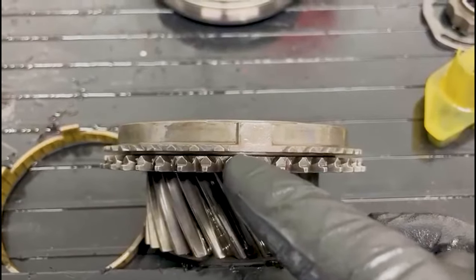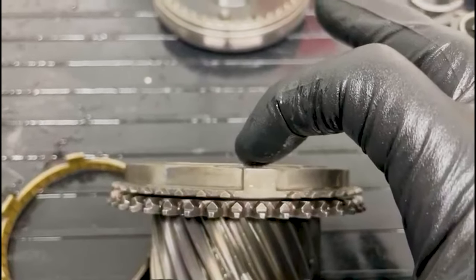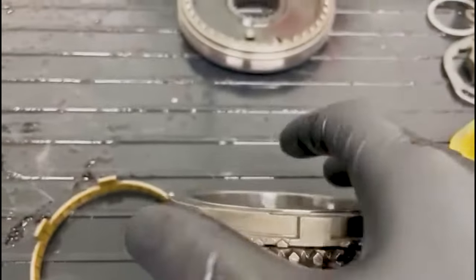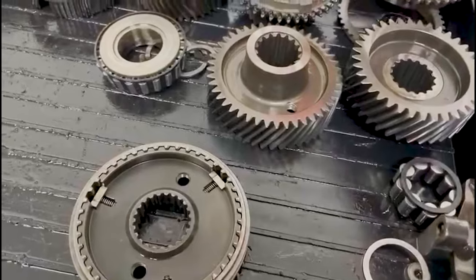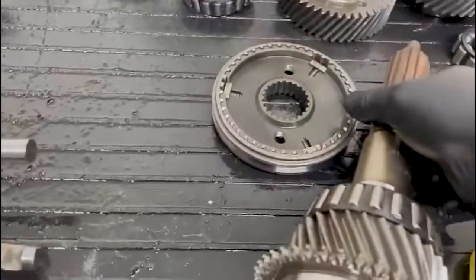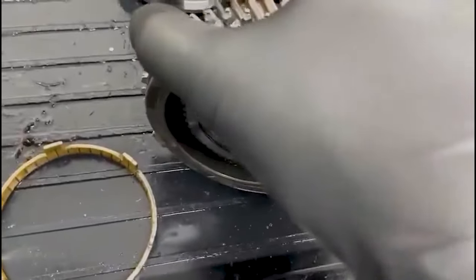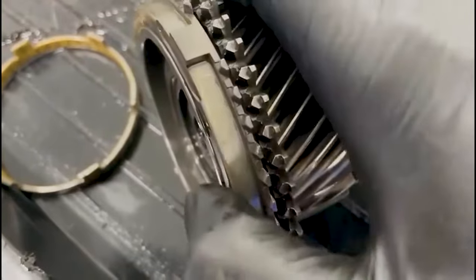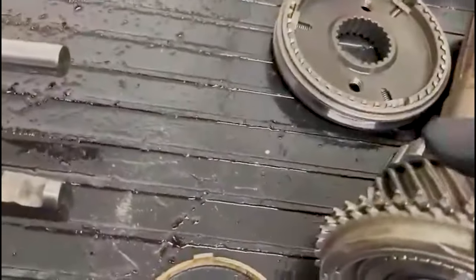But you can still see there's a good millimetre or so of movement there. But as you can see, it is starting to wear down. But it's a bit touch and go, that one, whether I'd really want to use it again or not. It depends how perfect you want to make this. And it's exactly the same story for fifth on the input shaft. You can just see there, it's just a little bit under flush, but I've got them if you wanted to replace them.